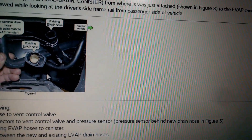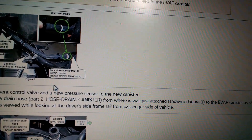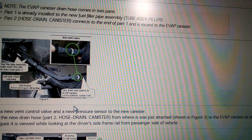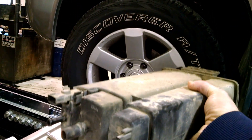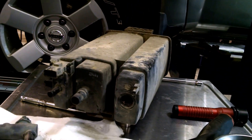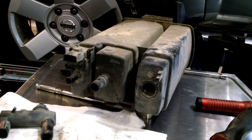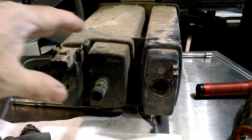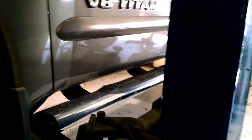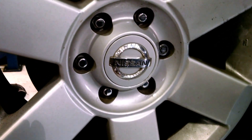On the computer I found an update kit that's going to move that hose further up, looks like by the filler neck, per a technical service bulletin. By doing that I think we'll be able to resolve this once and for all. Something you can't see on the video is just how heavy this thing is — it's got to be 20 to 25 pounds easily. We've put several of those on in the past and they're never anywhere near that heavy when new. So we're going to get a canister, which will come with the other valving and the update kit, and get this Nissan Titan back on the road. Code P0448 — thanks for watching.